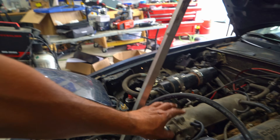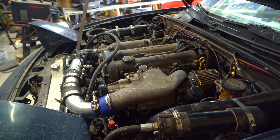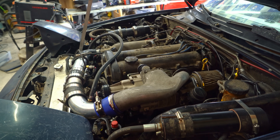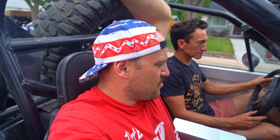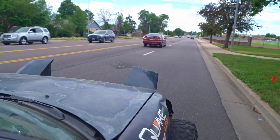We've done some redesigning on our setup. We were thinking it might be popping off the outlet because we don't have a blow-off valve and there's too much pressure, because for some reason the recirculating valve in the supercharger is not working. It's possible because we decided to do the throttle body in the stock location rather than relocating it. So we got a blow-off valve right there. It sounds way better. I think the blow-off valve was our problem — it just wasn't letting any air out when letting off the throttle. We didn't blow the charge pipe off, so that's the win. Our first successful lap around the neighborhood, maybe one mile. After days of work, we finally got it.